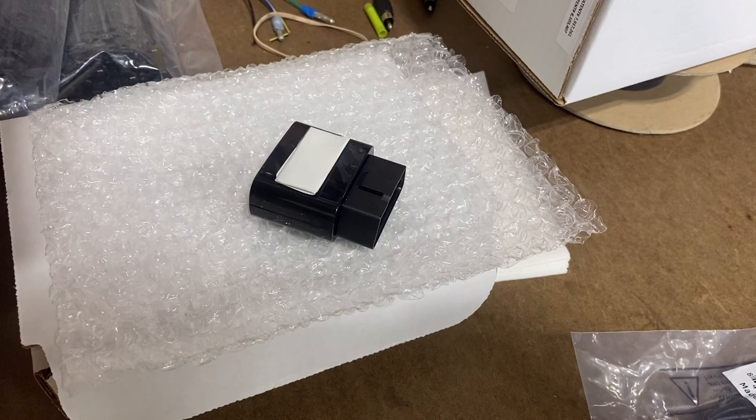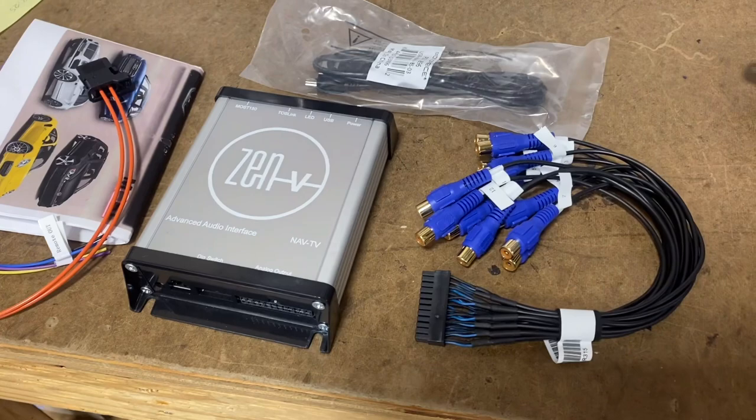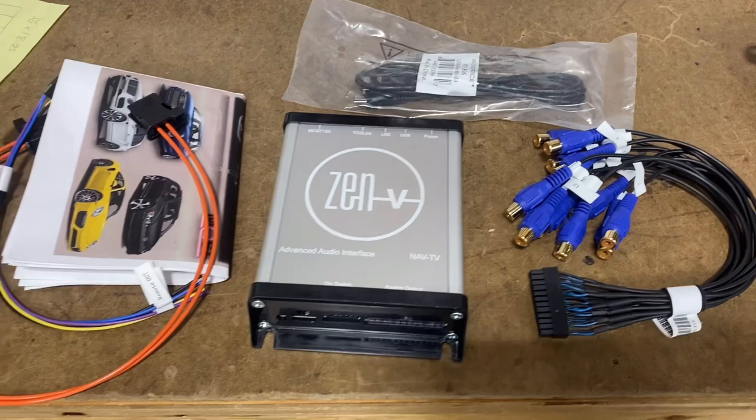Most of the time you're going to need a car that's already equipped with the stock premium sound for this to work, but it's definitely worth looking into — it's possible you may have one of these vehicles that can actually be reprogrammed. Usually we're trying to do this in cars where you have a factory premium amp, because those are the ones that have a digital signal before it gets to the stock amp, and you can interrupt it while it's still digital.